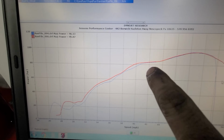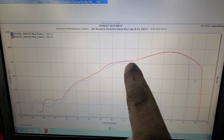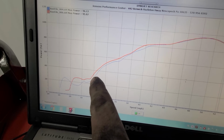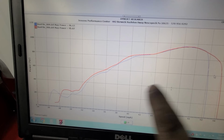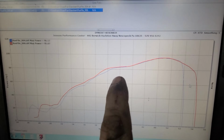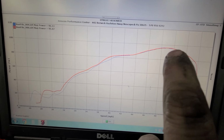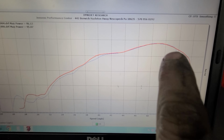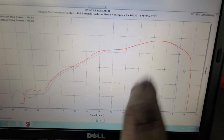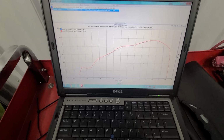Okay, which I don't have the RPM up, but I'm gonna say that's roughly 8,000 RPM because we don't start the pull until 5, 6. So 5, 6, so this goes to 11, halfway through. So yeah, we gained 2 horsepower all the way up to here, boom, and you can see that kind of mirrors it all the way through. And going from 10 to 11 did not help the power. The power starts to drop off about 9,500. So all in all, pretty happy.